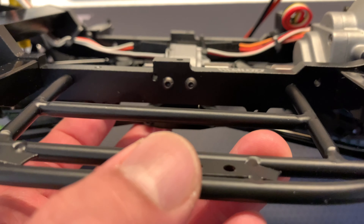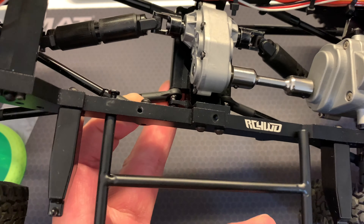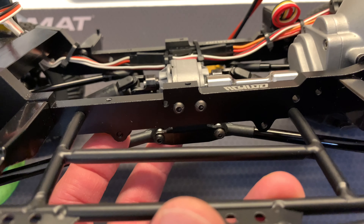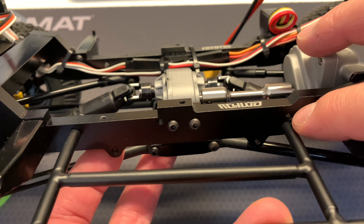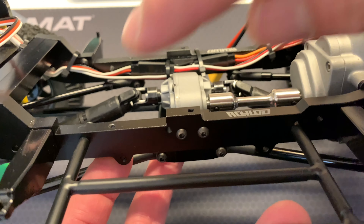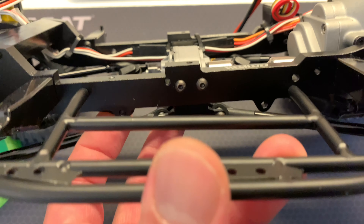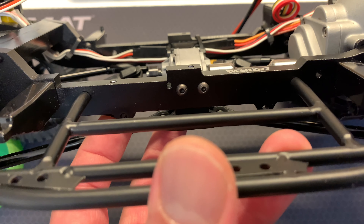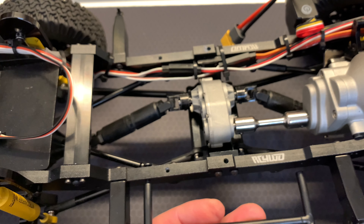...is the installation holes don't line up. As you can see there, once this side is lined up straight, that side there - the hole doesn't align correctly. So what I've got to do is stretch these legs out a bit. I hope that doesn't affect the weld or the paint too much, but what I'm going to do is just pull them apart slightly - I think it's about one or two millimeters off. So I'm going to stretch it and try and install it.